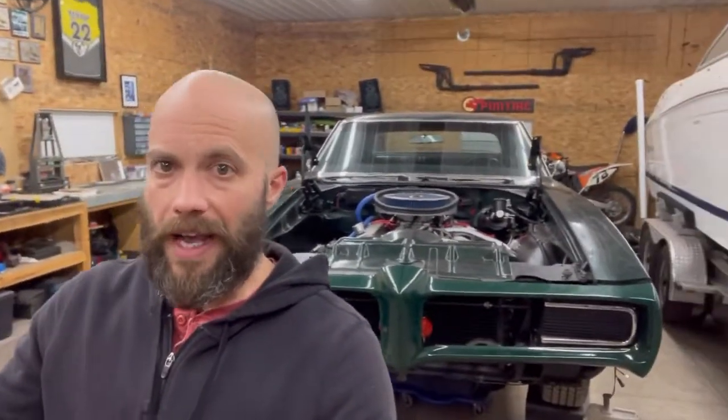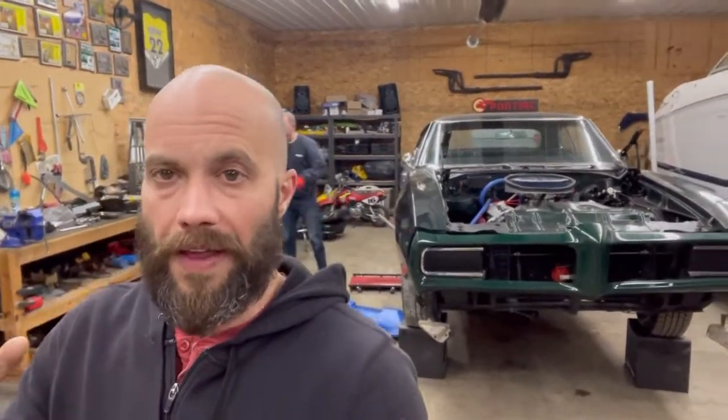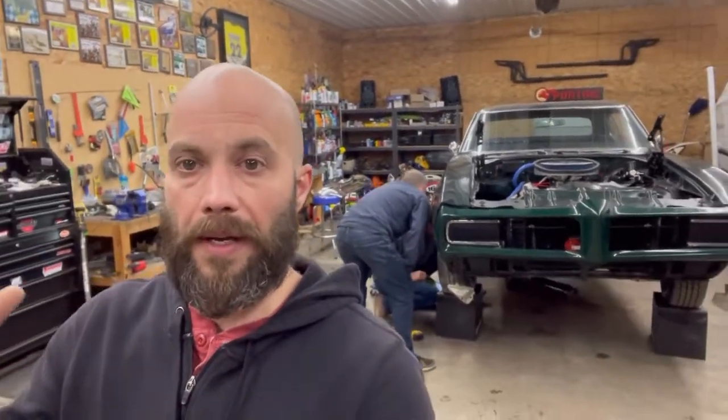What we're kind of doing now is going through and measuring stuff up. One good thing - I did a video and we discussed data books, and any information you can gather is valuable. I found a guy on eBay selling an actual reproduction of a frame layout with all the different mounts and holes showing correct measurements. We used that when we straightened the frame. Originally when we were marking points on the frame of where we thought it was bent, one method you can use is a plumb bob - put little dots on the concrete below the car and start measuring from that. You have to make sure the car is level as it would sit normally. The long side of the frame is referred to as a datum line, and that is really important when you have something bent.